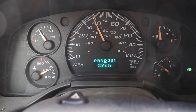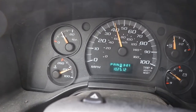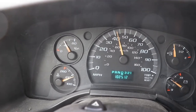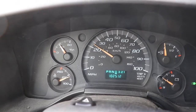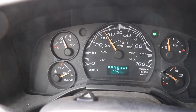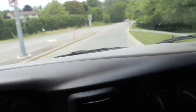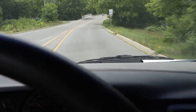It's been about 1,200 miles since I did the front brake job on the van. I'm happy to report that changing the brake pads and front rotors fixed the death wobble in the vehicle. You can see I'm slowing down here with no problem whatsoever. I'll go park the vehicle and we'll talk about overall what I did, then wrap up the video.